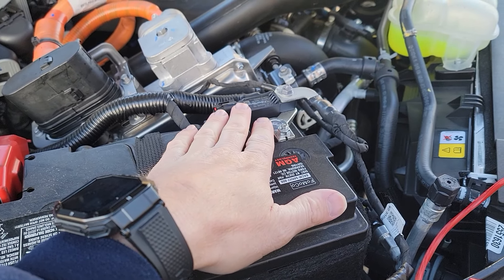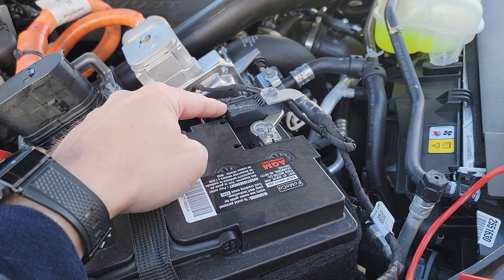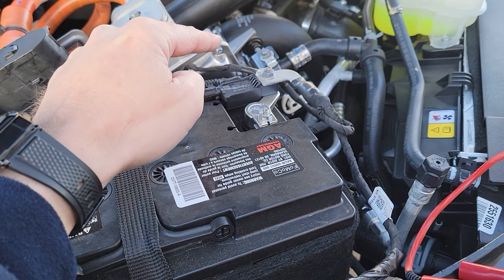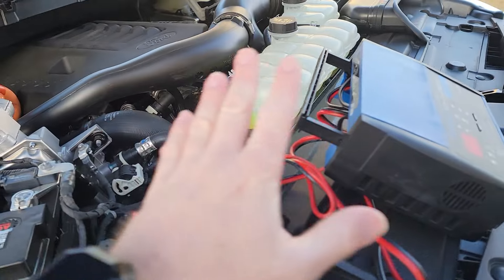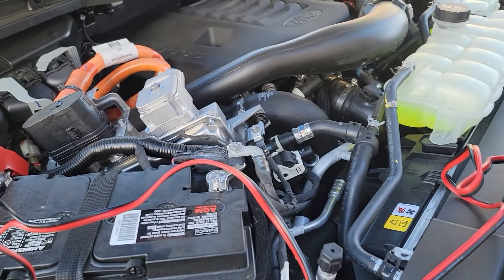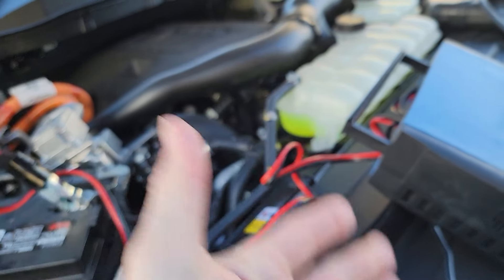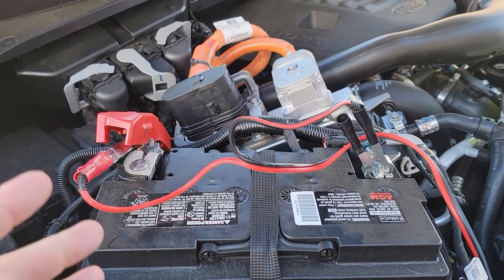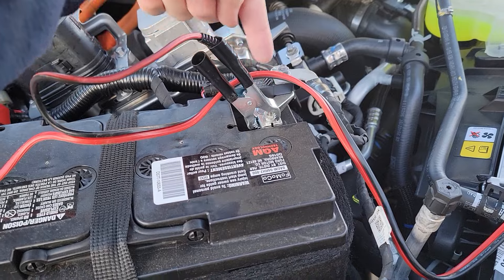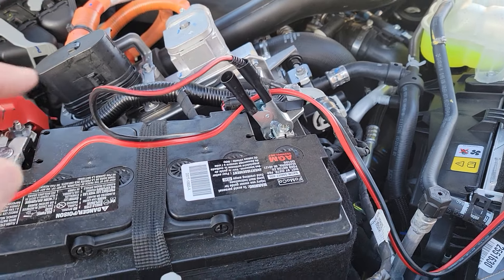A handful of years ago, they started putting in battery management systems, hoping to retain enough battery to start the vehicle. If you look at your battery and you have a box that looks similar to this, this is the battery management system — BMS — whatever acronym each manufacturer uses. What'll happen is if you come over with your battery charger and hook it up to the standard terminal here, then hook your negative terminal to the negative, you can leave the charger on for hours and it'll probably still show low voltage, seeming like it's taking forever to charge. If you have one of these BMS boxes, the actual negative terminal needs to be on the opposite side of the post, so it'll charge much quicker. That tells the vehicle you are charging the battery and that it's not trying to shut it down to maintain battery voltage.